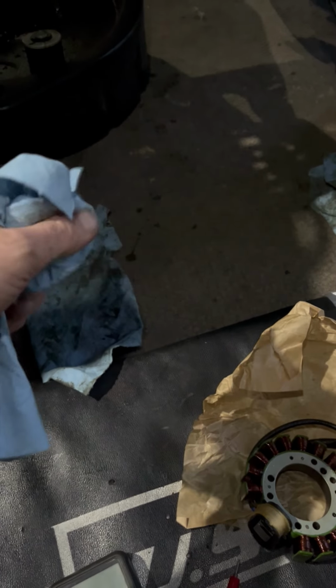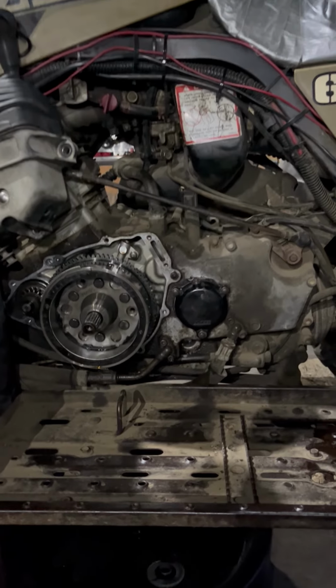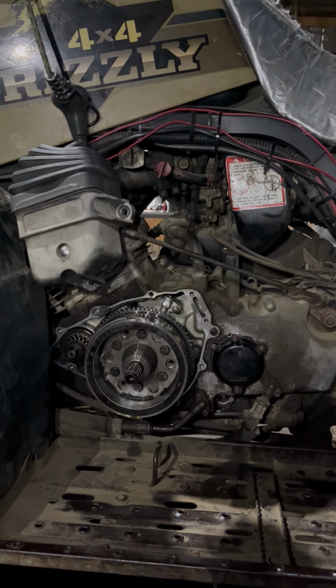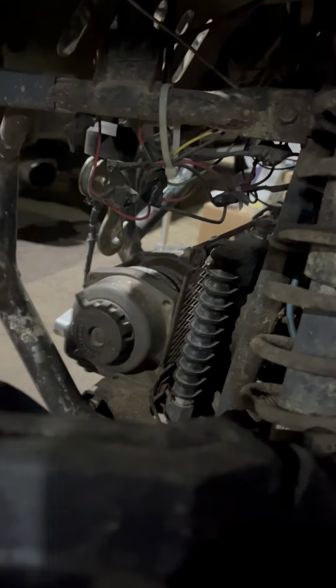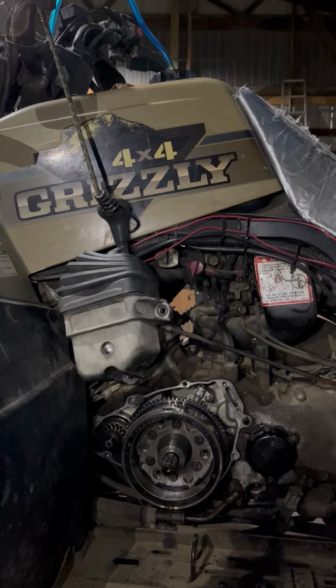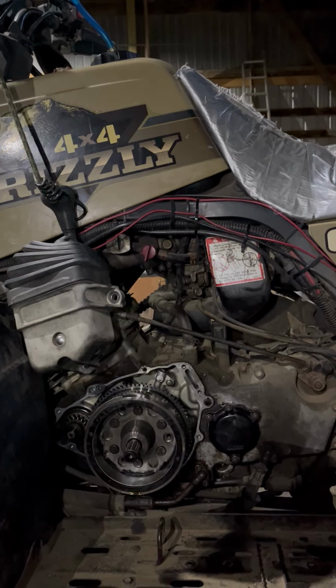And I got more spark plugs. They already came in. I'm using 15W40 Royal Purple. It calls for 10W30 Yamalube. Like I said, maybe there's something that burns the stator out, but the full synthetic stuff is supposed to dissipate heat better than the other. I've got the fan fixed, which you can see right there, so that it runs. It hasn't run for a couple years. The sensor went out, and I just hardwired it in a couple weeks ago so that I can run the fan all the time. But these things produce a tremendous amount of heat.